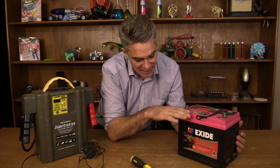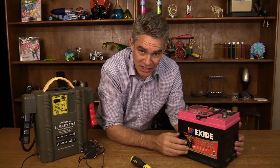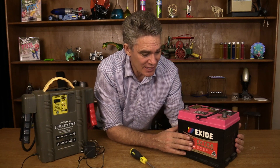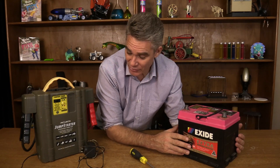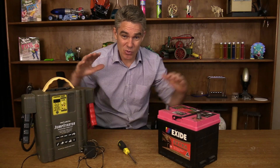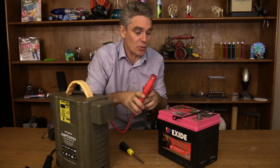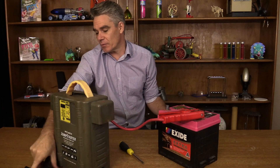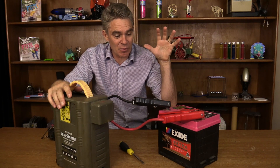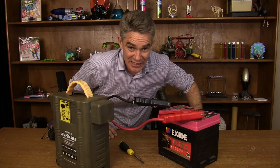They'll be used to start the car, which uses up some charge, but as soon as the car is running it charges up again. When you turn on your lights it discharges, but the car's alternator keeps it topped up. If you've left your car lights on overnight and your battery's dead, you probably need to jump start your car. One way is to get jumper leads and connect two car batteries together, or another way is to use this jump pack — the red terminal goes to red, the black to black, and the battery from this jump pack transfers its energy to start the car.